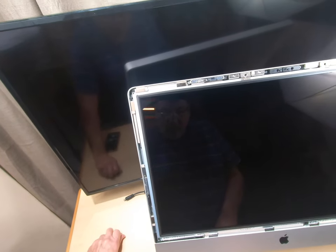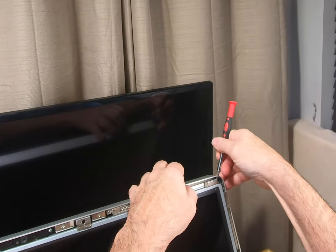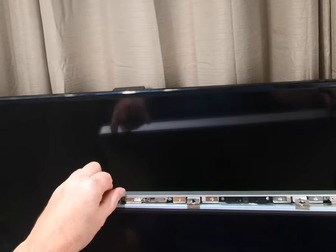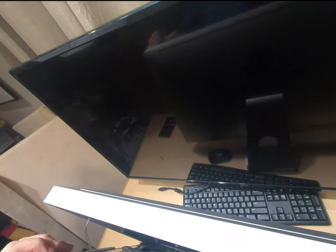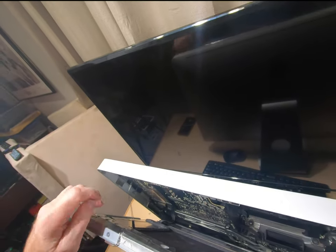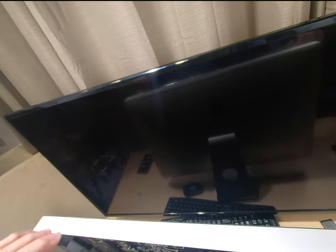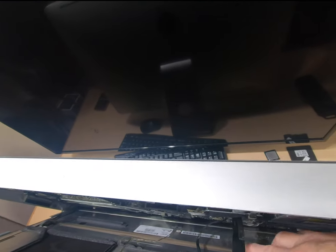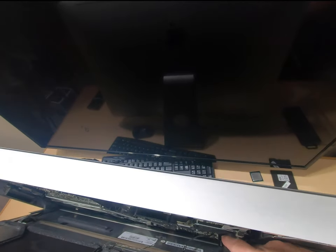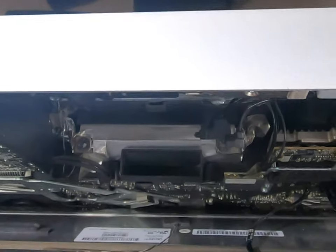You don't want to get too excited about pulling this LCD out because you'll break some cables on the other side. I'm going to get my screwdriver behind it and just gently pull back. Now hopefully you can see in here — we've got a wire that we need to break loose here, and we have to be really careful with these ribbon cables down here.